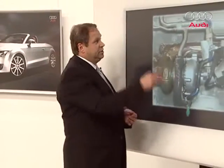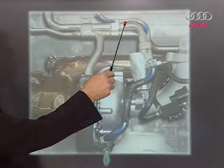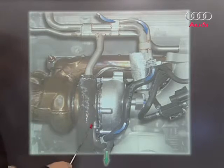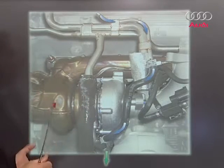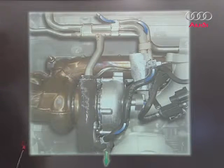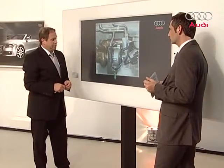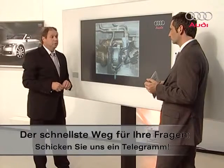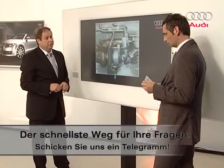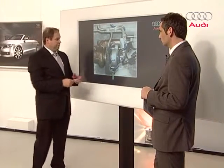Is it possible that the oil-air mixture might end up in the air cleaner? That would be possible if the following happened: the non-return valve is installed up here so that air can only be extracted in one direction. If the oil extraction rate or RPMs rise, it would create a vacuum strong enough to pull the oil up here. That's why we have a non-return valve to hinder this. If a vehicle arrives that uses an inordinate amount of oil or smokes when started, check if there is oil in the air cleaner. If there is, the non-return valve is broken — if you drive at full throttle, the oil could be drawn through.